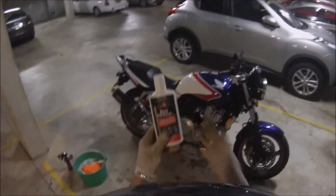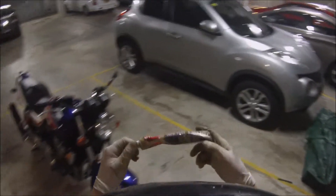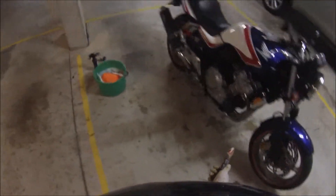Doing the steel wool takes about two to five minutes. Next is the Metal Lifesaver corrosion and stain remover by Autosol — if your pipes are brown, this is what makes them silver again. I'm going to do one tube at a time. It's very much like the stuff you use to clean the wheels — get it on there, you'll see a little white layer of the product. Just leave it there, let it sit, let it work its way into the metal.